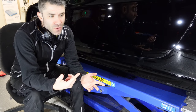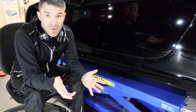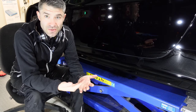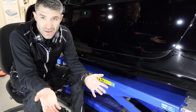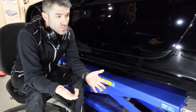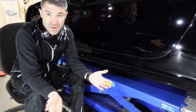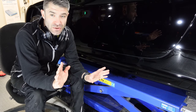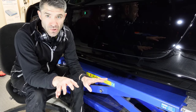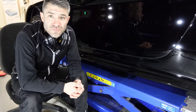When we come back tomorrow, we'll do a very light wipe down because we've used the primer polish, we're not using solvent-based panel wipes. It will just be an oil removing or a standard detailing wipe down product, for example like Gyeon Prep. In this case I will be using Envy Car Care Filler Killer. Won't be spraying it over the car like we normally do with a panel wipe. It will literally just be a case of a couple of light mists on a plush cloth, just buff that surface down just to make sure that anything that might be sitting on it is removed. It won't disturb the primer, it won't disturb the resins, and then we will coat directly over the top of that. So let's go get it.